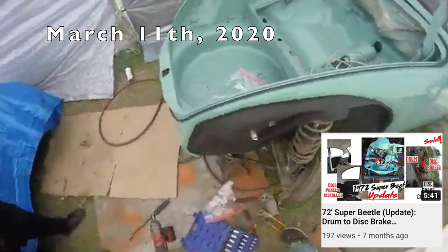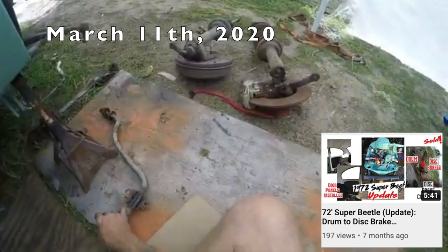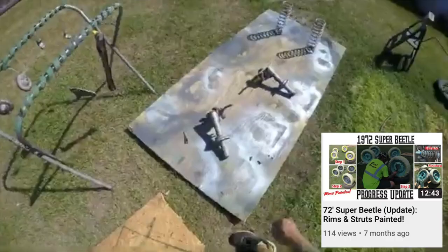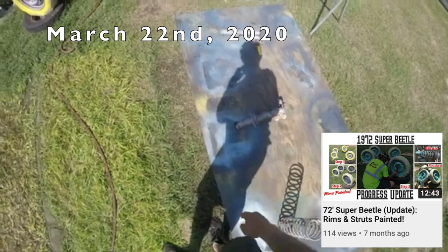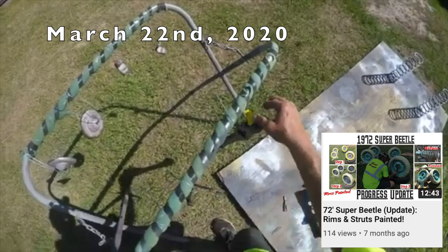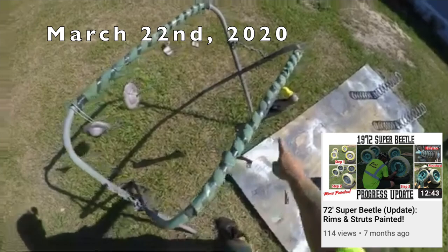We've got new sway bar bushings, new arm bushings, new ball joints, and she'll have new disc brakes on the front. These are the struts disassembled. I've got the cylinders, or shock inserts, for them on order. They're not here yet. And then only one ball joint came in, so I have the other control arm set aside because I'm going to have to scuff it all up and fresh paint. All the bushings are in, so all of this is going to get chassis black.